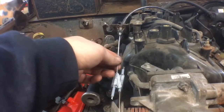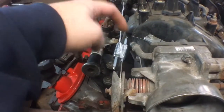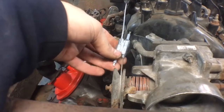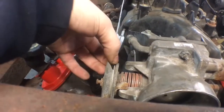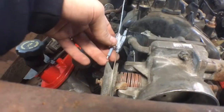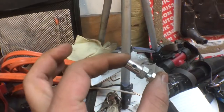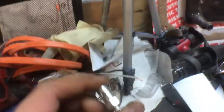My dad brought this home from work one day. It's like three feet of cable and it comes with this lock. It'll only lock one way — it's like a one-way zip tie kind of deal for cables. This is the GM side that goes into the throttle body. This side had a big hook end on it, which clearly wasn't going to work for me. There was excess out the back, and it clips to the pedal with a cable lock that I've snubbed down. I pulled the cable tight, tightened it down, took some slack out, trimmed the cable, and now it works just fine.